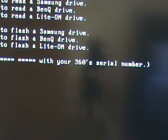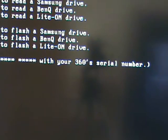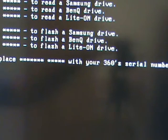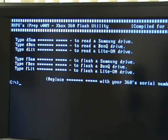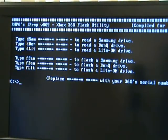Alright, once we get to here, I'm going to hook the drive up, which I have the bottom of the drive taken off right now. I'm using a connectivity kit right here, and I've got the bottom off, and at this point I'm going to hook the drive all up, eject it halfway, or eject the drive, then power it off, close it halfway, I usually go a little more, and power the drive back on. Now I flip the drive over and I've got my probe ready because I'm going to pull the key with the probe.